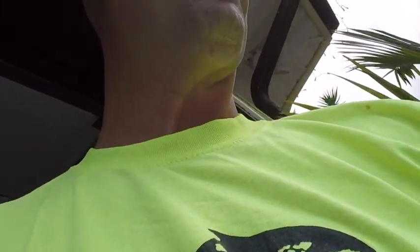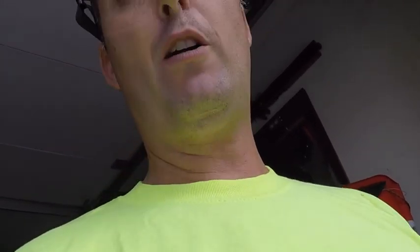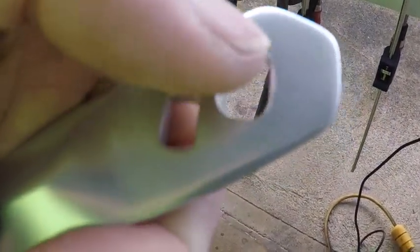One thing I would add is that when you do cut these handles, you're going to be exposing, especially if they're painted or they've been plated in chrome or something like that, the edge of the metal. So it's very important for corrosion protection and keeping the metal from seizing that the inside that you cut, slather it with a nice thick grease. So put a nice big thick grease inside, on the bottom, and on the top. And you shouldn't have to worry about anything. Just make sure you grease it.